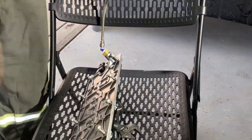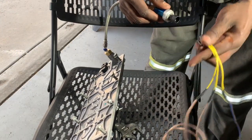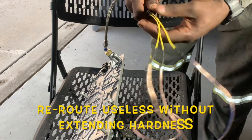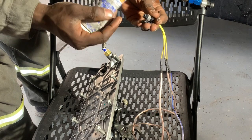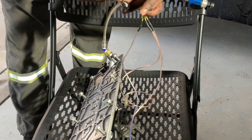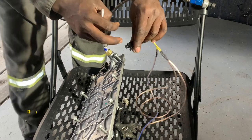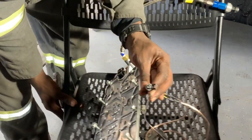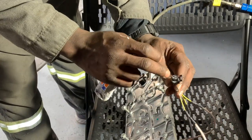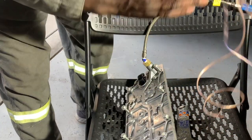When it comes to the harness, here's the trick: even if I route it, the harness may not be long enough — my estimations are that it's going to be pretty tight. So I got a kit that included the harness and I'm going to extend the current harness. I'm going to put a little dielectric grease to make sure it has good contact with no corrosion. Whenever you remove the filter, this piece sometimes comes out of it, so make sure you get it. Sometimes it's yellow — in this case it's aftermarket.